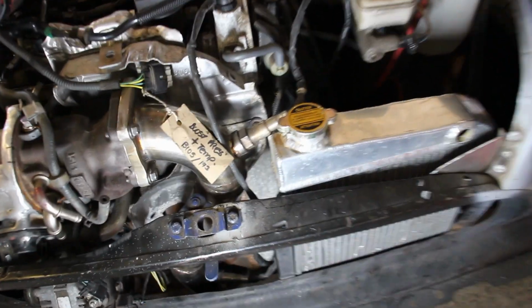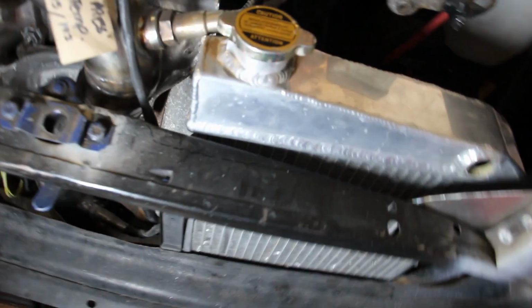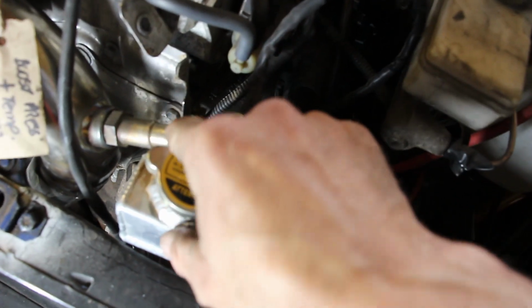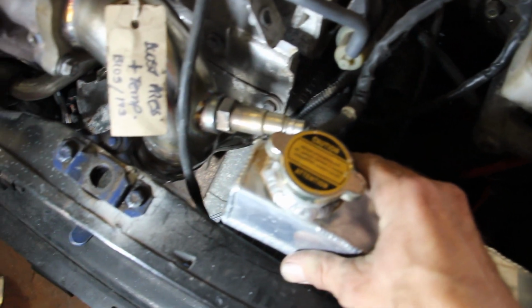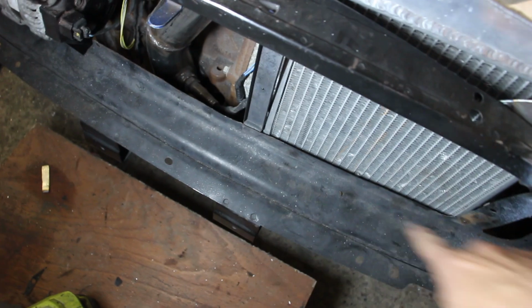So I did shoot myself in the foot a bit with the positioning of the lambda sensor. Just 10mm that way and my life would be easy. But as it is, it's not, and it's not there. So we've taken a little corner off the radiator. It's not going to be a major performance issue, and we've got the clearance we need. Little fettle here, little fettle there.